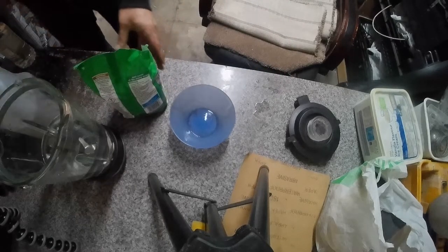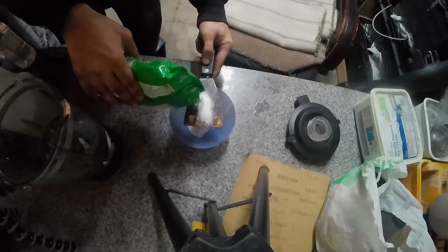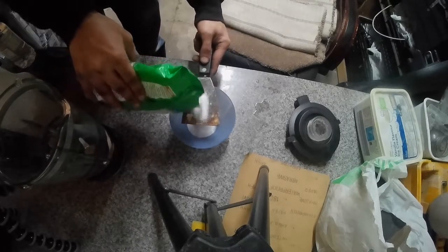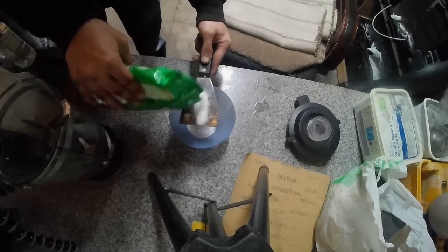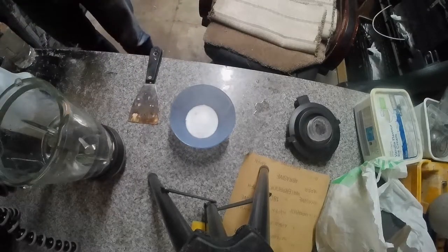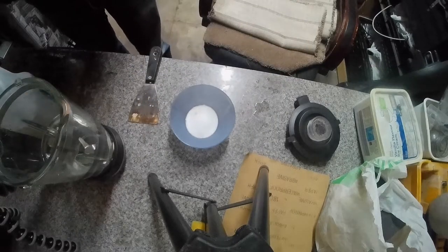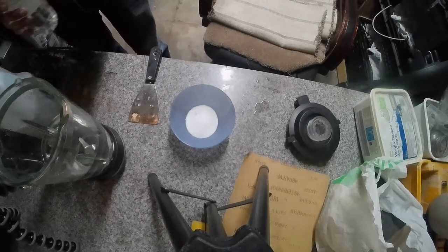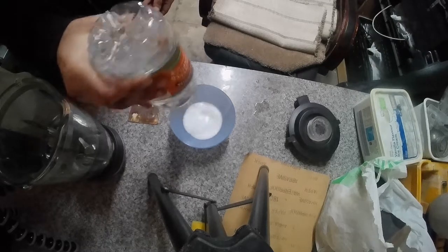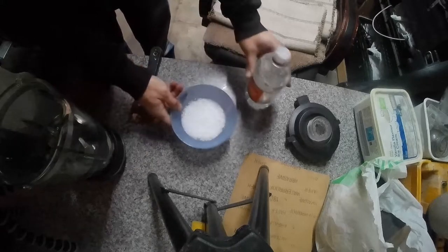Here we're making the mix — what are we going to flush it with? It's being flushed out with soda crystals, also known as baking soda or bicarbonate of soda. I'm using a spatula — roughly about 60 grams of the soda crystals. Then when you put white distilled vinegar in, it'll start frothing up. It's actually a good solution to flush out your cooling system — gets rid of all the grit. See how it's frothing up like a shampoo kind of thing.